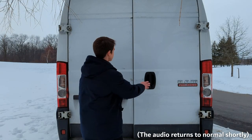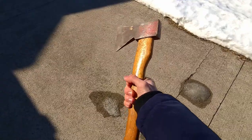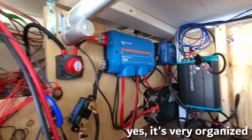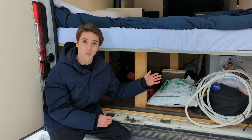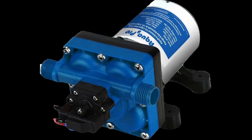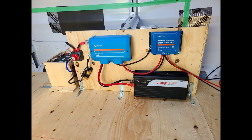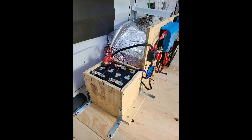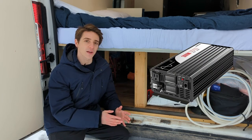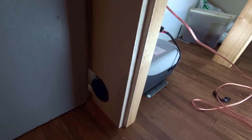And back here is the garage. This is where I store things like my tools, my shovel, my axe, my hose, as well as my diesel fuel canister. It's also where my water tank and electrical system live. I have a 32-gallon water tank that fits over top of my wheel well and connects to the water system in my van. I have a regular 12-volt pump that I turn on and off with a switch and it pumps right to my sink. My entire electrical system is also underneath here — I have a DIY 230-amp-hour lithium battery, a 2,000-watt pure sine wave inverter, 350 watts of solar on the roof, and a 40-amp DC-to-DC charger. Also housed back here is my diesel heater.